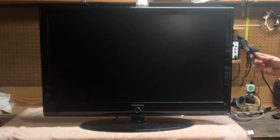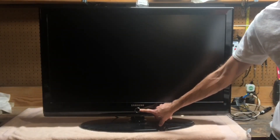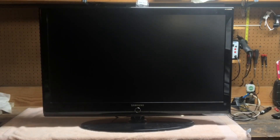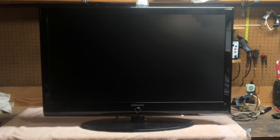I'm going to show you what it does. Plug it in and watch the standby light — it flashes five times, then you can hear it click and it'll try to power up. It clicked again, trying again. Earlier when I tried this it did the whole click cycle probably three or four times before it powered up. I'm pretty sure it's a capacitor issue on the power supply board.